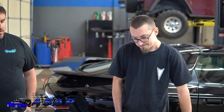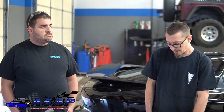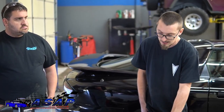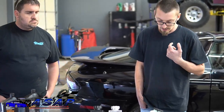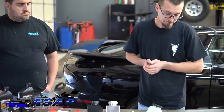I had my 2001 Trans Am and I went through about four power steering pumps over a couple of years. The car was a stock LS1, I had 4.10s in it, a six-speed, and I'd run it hard on the street. I kept having problems with the pumps — I changed the rack, put new lines in, and it just didn't make sense. So I did more research, figured out it was a common failure point at the stock pump, and said there's got to be a better way. I started doing research and basically came up with this kit as my own solution.